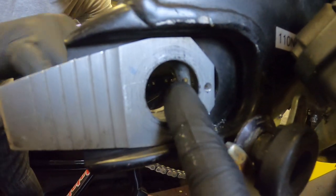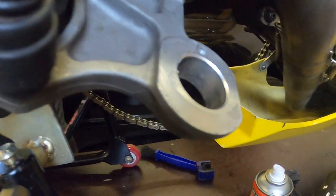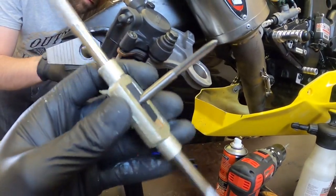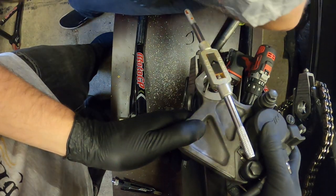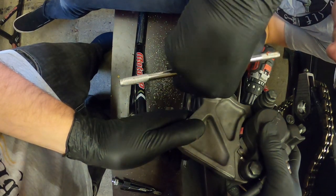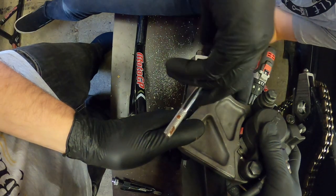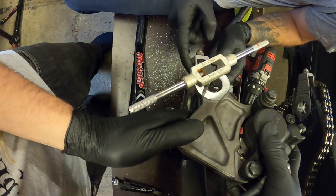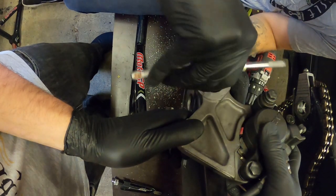So what we've got now is a through-hole lined up with the hole on the actual carrier. What we'll do is drill a little bit more depth into this and then tap it. Those fancy drill taps — they look like they go really wrong really quick, you just end up with stripped threads. We're going to have to open up the hole on that to get the bolt head through — we drilled it for the tapping size but the rest of the bolt is bigger.